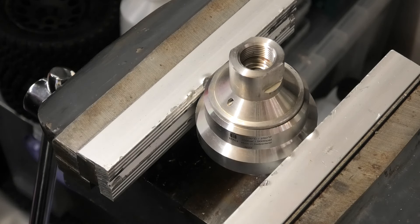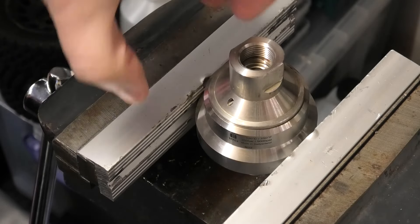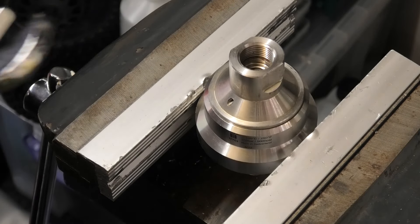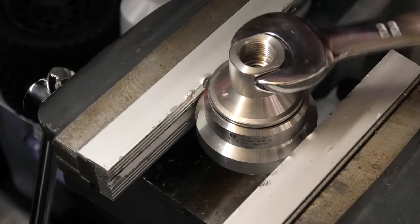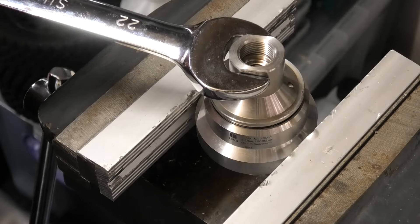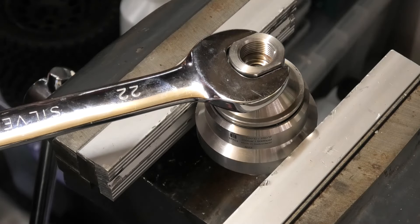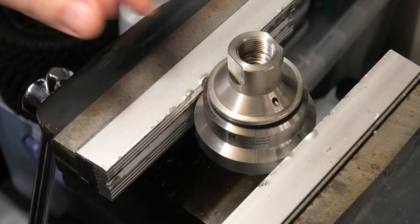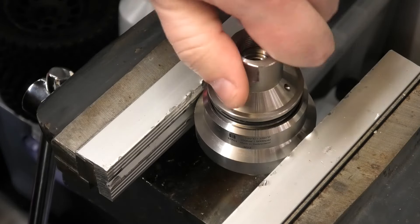When I first did this I had to put it into the steel jaws because it kept slipping. You will need to put some heat on this because of the sheer amount of thread lock. I have had this apart already so it will come apart quite loosely — don't think yours will come apart this easily. I heated it gently with a MAP torch, just to get it a little bit warm, not too hot, all around the outside. There's quite a lot of sealer on it. Once you've warmed it up, get your 22 mil spanner, crack it off, and it will undo quite easily. There is an o-ring just underneath, so once you've cracked it off you should be able to spin it off by hand.